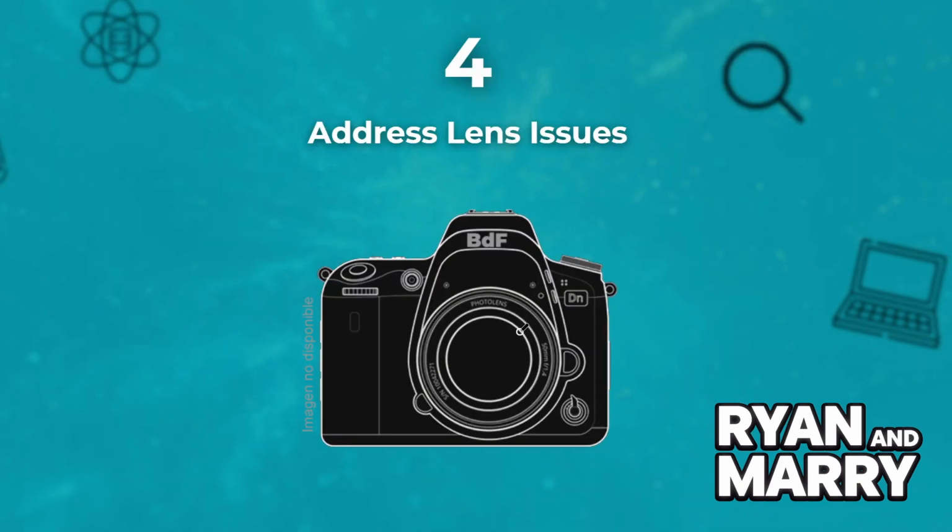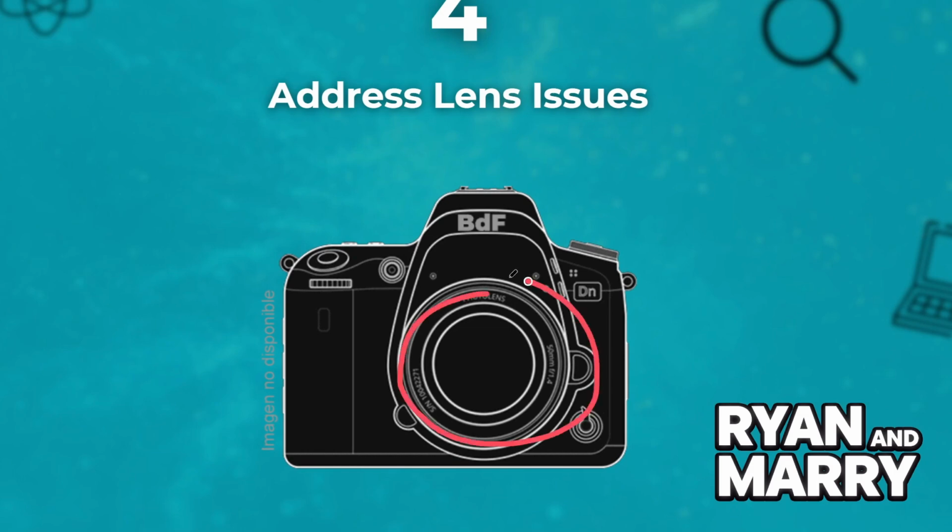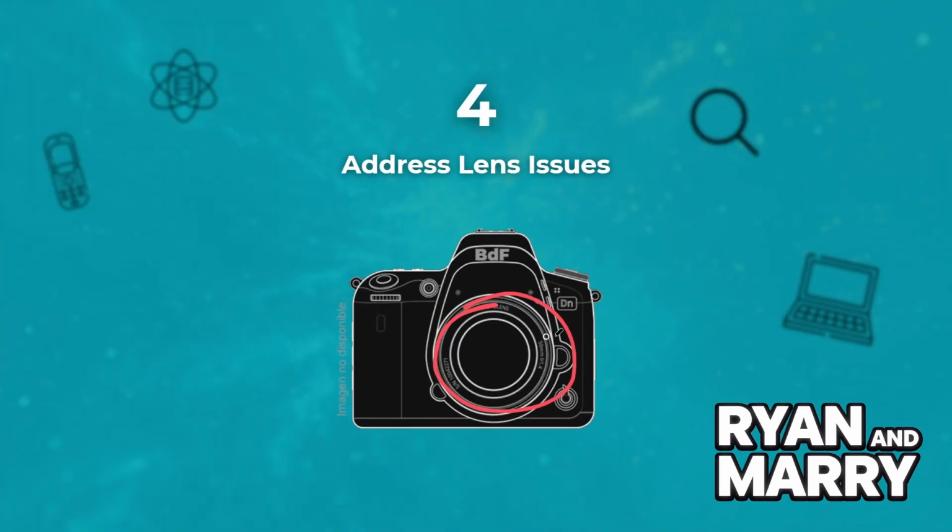Step 4. Address lens issues. If the lens is stuck or won't extend, gently clean around the lens with a soft brush. Power on the camera while gently assisting the lens movement. Lightly tap the camera on your palm to help free any internal jams.